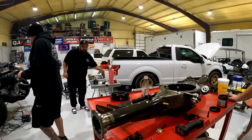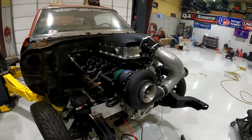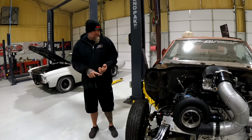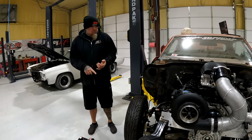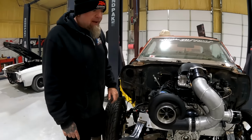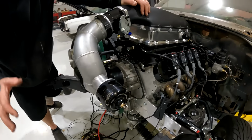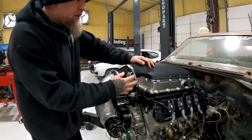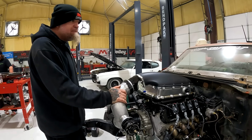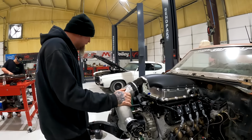Come over here. Nothing to it now but to finish it. Yep. Can we turn the fans on to suck all this smoke out? Yeah. We will. We still got to put the water tank in the trunk. Fuel system's done. Hopefully by the end of today, I can get these things filled up. If we can find some solid stock aluminum, I'll put the alternator on it today. And then we can put the front end back on it. Still gotta put a throttle cable on it. Bunch of easy stuff. Down to all the little stuff before we can drive it. We have no drive shaft yet. We did measure for it, so it's coming. And then a shift linkage, and we should be good to go.